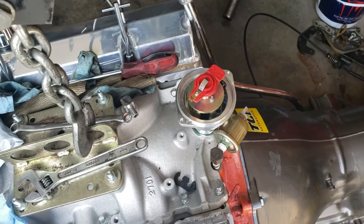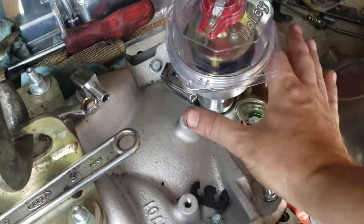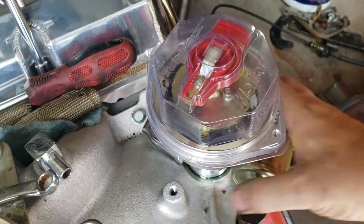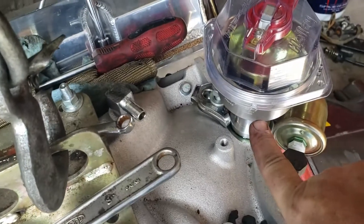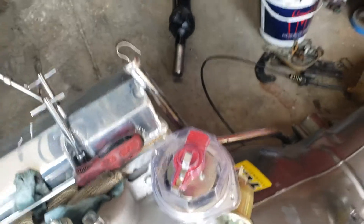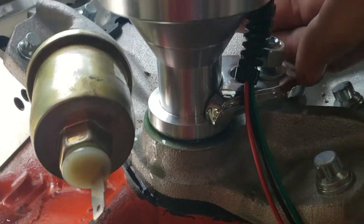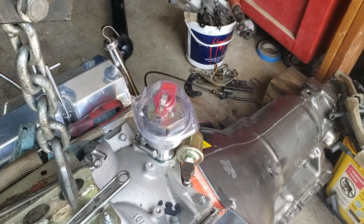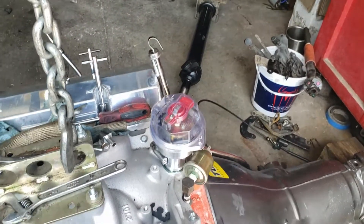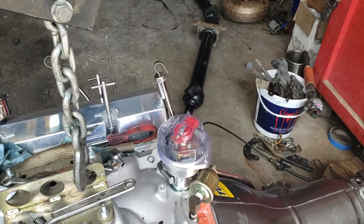It took me about five minutes to get it done. My oil pump was a little out of whack, so this just tells me how far out that is. That looks good. I'll probably make a little mark right here which is number one, so all that lines up good. I can go ahead and tighten that down with my screw in the back right here. The first step is done. Now I'm going to screw everything down, tighten everything up, put the real cap back on, mark it from number one, and officially put the motor in the truck — hopefully for the last time.